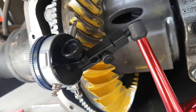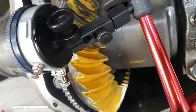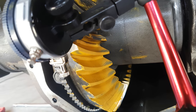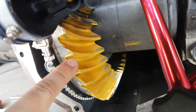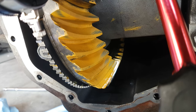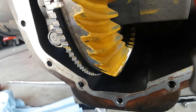This is my first retest. I tested one time before, adjusted the shims on the pinion — it seemed too low. The pattern was clear at the top, so I added five thousandths.